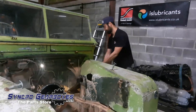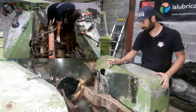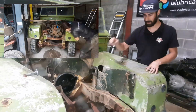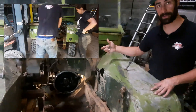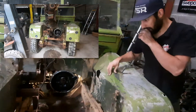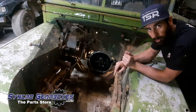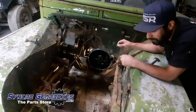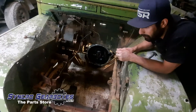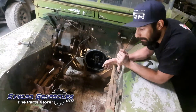So we're doing alright actually. As you can see we've taken the engine out, which wasn't too bad to be fair. Even though this mount had sheared off — the rubber had sheared and undone that mount. All the bellhousing bolts came out really easy which was nice, and that was pretty much it. So we've pulled that out with the fork truck as you've seen. The cross member in here — the original cross member has been taken out to fit that straight six petrol engine in, and they've just done a really bad job of it. They've just welded in a bit of angle iron, done that really poorly as well, so that's a bit more work for us and we're going to have to put that back in.